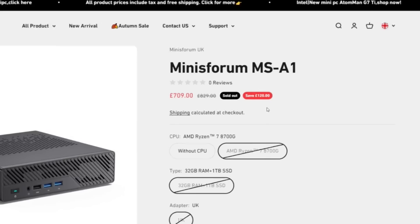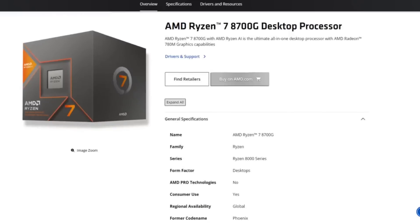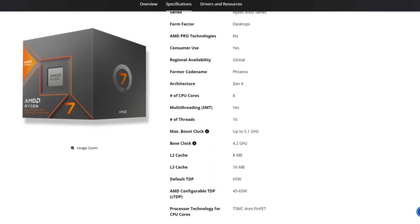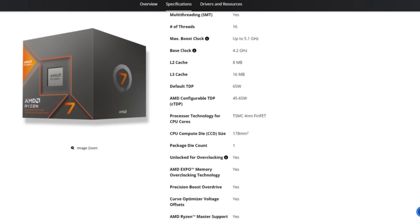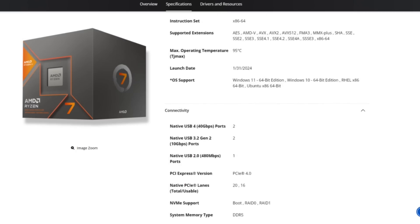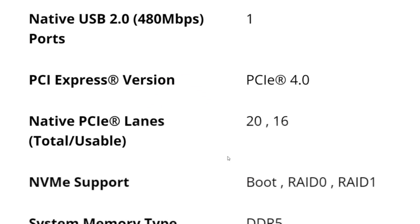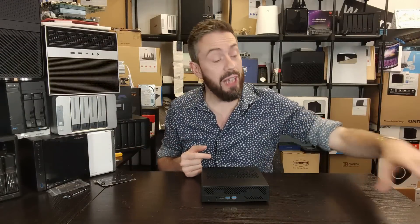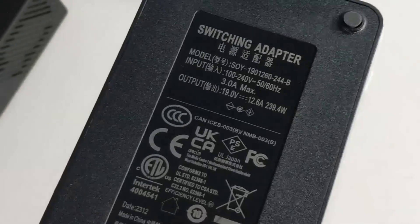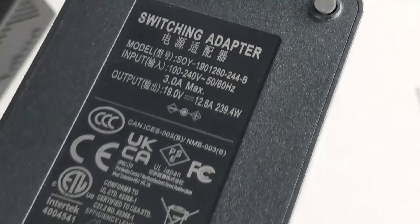The power user version comes in at around $420–430 and arrives with an AMD Ryzen 8700G CPU — 8 cores, 16 threads, 65W TDP. That's beefy consumer hardware, but it's not really the most NAS-friendly CPU for 24/7 use given the power draw. And we should address the elephant in the room early: the PSU for this device is the size of Dumbo — a 240W external power brick, and it's as heavy as it looks.